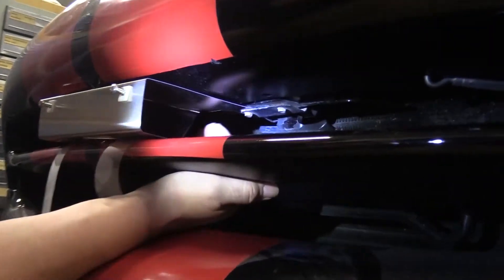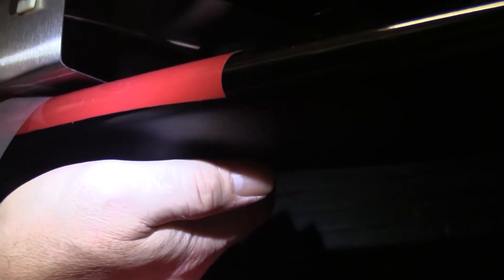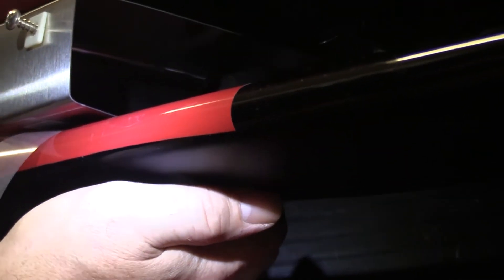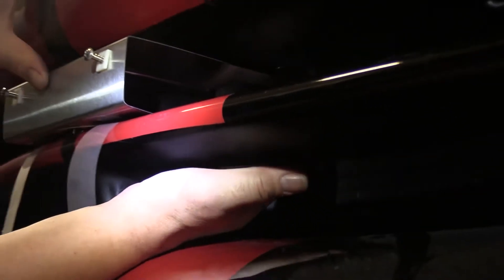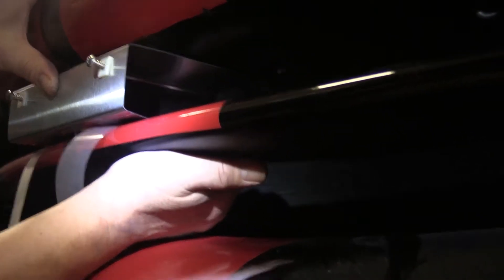Your bracket is going to come with these little tabs. What we're going to ask you to do is to just bend these down around the lip of the bumper grill — pretty easy thing to do, it's a light gauge metal. Just push these down and that's going to lock the unit onto the grill. You don't want this thing flying out at 150 miles an hour, so the screw is basically going to also lock the unit in as more of a safety item. Then bend all these tabs.